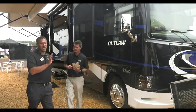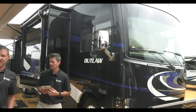The difference is that a Class C would be a 2-valve V10, where a Class A is going to be a 3-valve V10. I think that's the biggest misconception, that people are looking and saying this is the same engine versus another, when it's not. That's how it is across the board in the industry. A Class C is a smaller block V10 engine versus a bigger one in a Class A. And it just so happens we have a Class C right here.